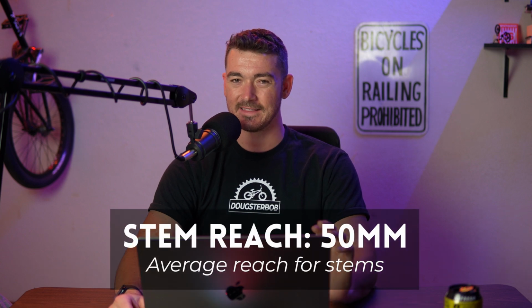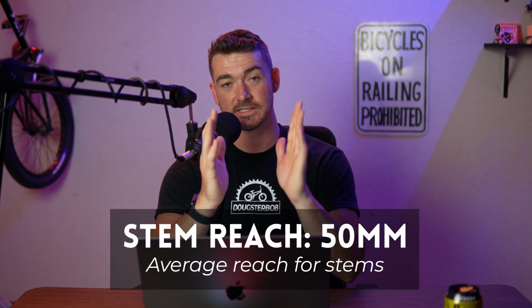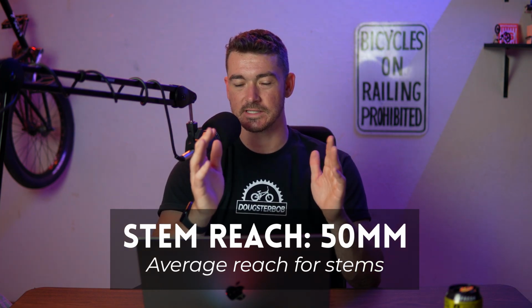The stem, I think, is 50 millimeter reach. This is how far the handlebars are from the center of the stem and the center of the forks. Having longer stem reach is going to make the bike steering more stable, so it's not going to respond as quickly to steering. While if it's shorter, bar spins are going to be easier, and it's going to be really responsive on the steering.